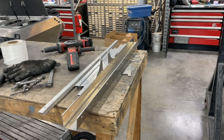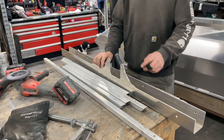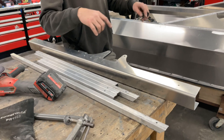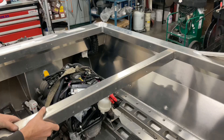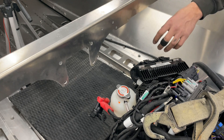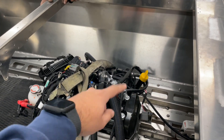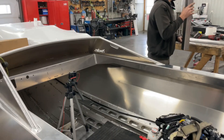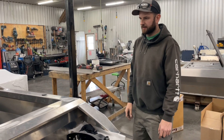There's a sneak peek of the crossbar which will be coming up soon along with the engine cover. There'll be one main cross member running across the top — leaving it out for now for access. This ends up being a ring frame around the edge to support the engine cover. There are mounts on the back for the sand trap, the stock coolant bottle gets relocated to a bracket up here, there's a hanger for the air filter, and an engine electronics bracket that'll sit on top as well. The engineering done on the front end makes it all much easier to install now.